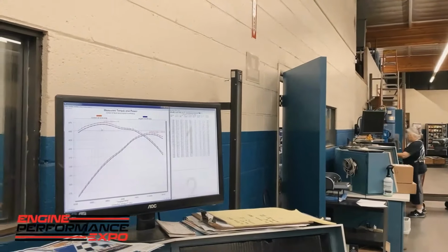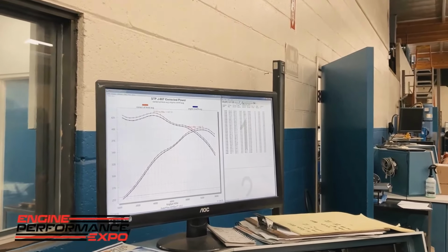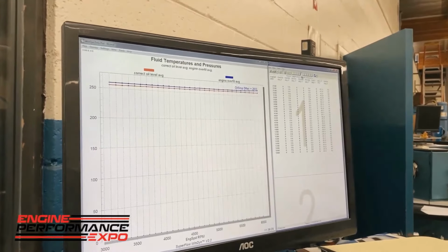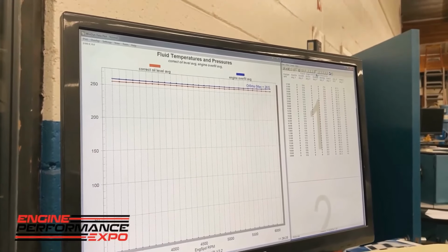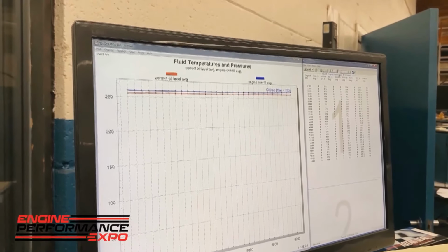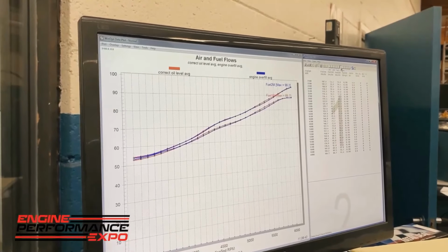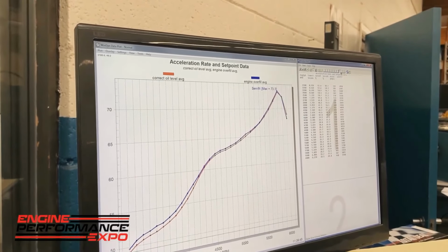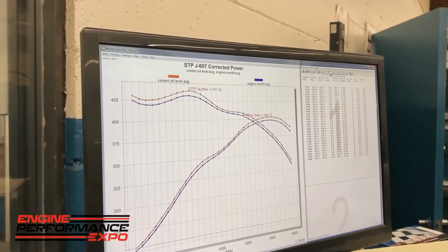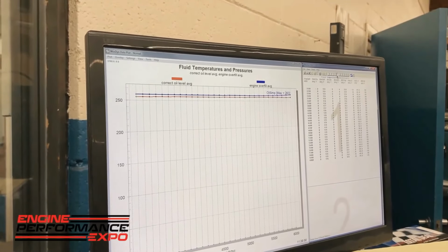So, Travis, we can look at more than just torque and horsepower. Absolutely. So let's look and see what other changes may have happened by this overfill. I imagine you'd see a difference in oil temperature. As you have more windage, you're going to be beating that oil, and we see a difference in temperature there. There's a slight difference, and one of the other things, if we can put on the same screen, is the oil pressure. We have seen before that because we are working with a crankshaft that's hitting the oil, it does foam the oil, like Travis just said, and it will start aerating the oil, and the oil pressure will actually come down.